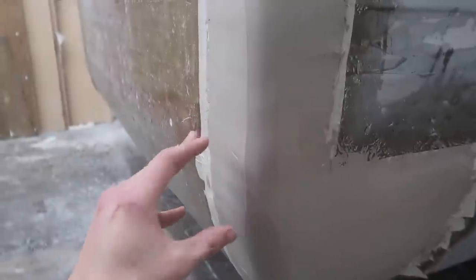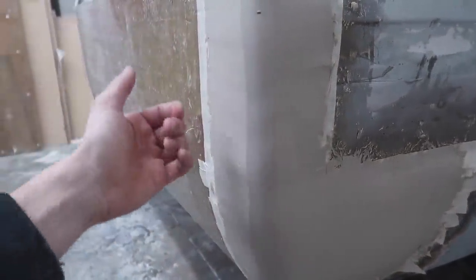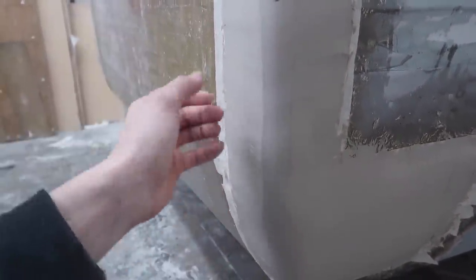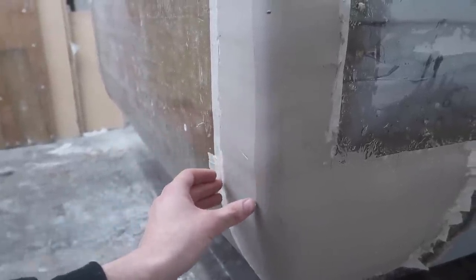So it's pretty much at the shape that I want it to be at the final form. It's a little bit bigger, but now it's time to slim it down a little bit and prepare it for the tape and then fiberglass. So this bulge out here is a little bit big, but you can see it's pretty smooth, and by the time we do a few layers of fiberglass and then do some filler work, it'll be more than okay. Obviously we're not going to be able to block this stuff or anything to get it perfect,